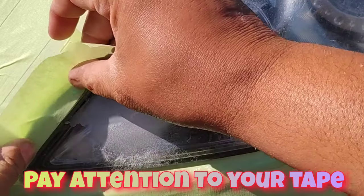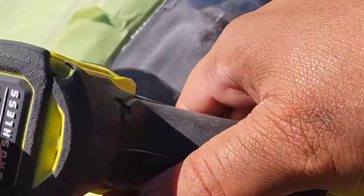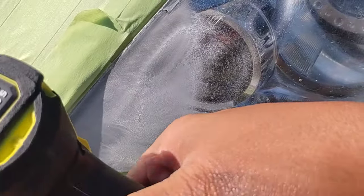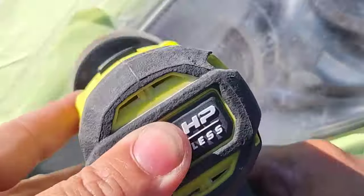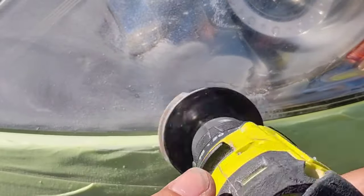From the factory, it is not vehicle clear coat that's on headlights. A vehicle clear coat is nowhere near a headlight coating on a scale of UV protection. A clear coat typically doesn't have that much UV protection — it's not designed to UV protect something underneath it so much. It's more designed to make something glossy and provide surface protection, not UV protection, which is different.